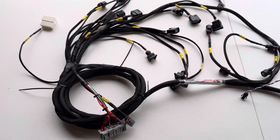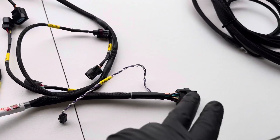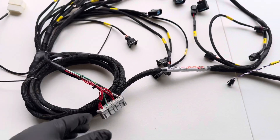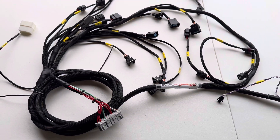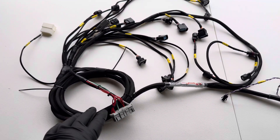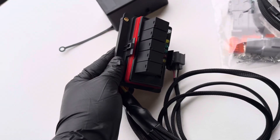So you just need to hook up the C101, the E-connector, the ECU connector, load up a base map with the pinout that we provide to use with this specific unit, and you're good to go to start the engine. This can also be started on the engine stand if you use something like our universal fuse box for the K-series.